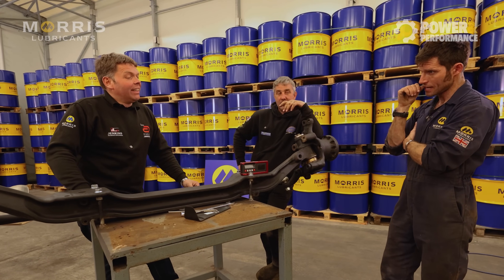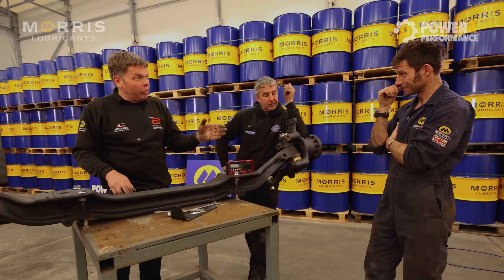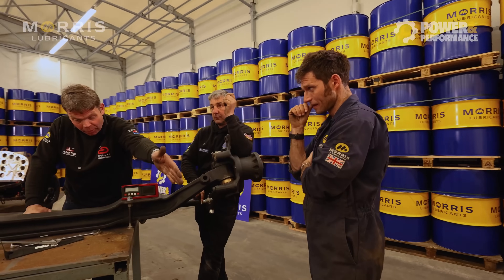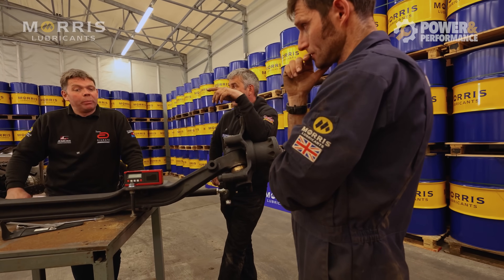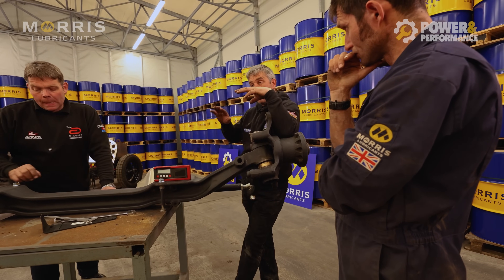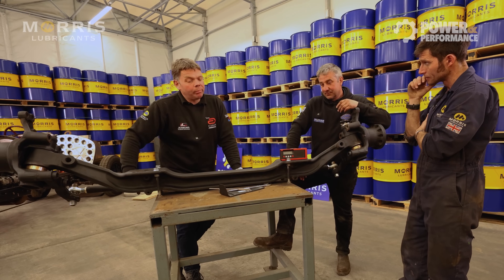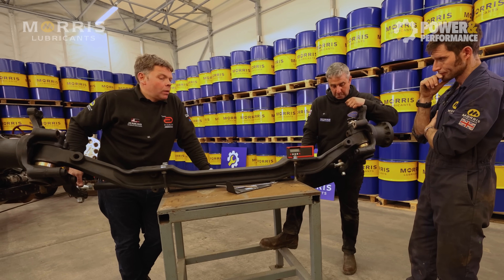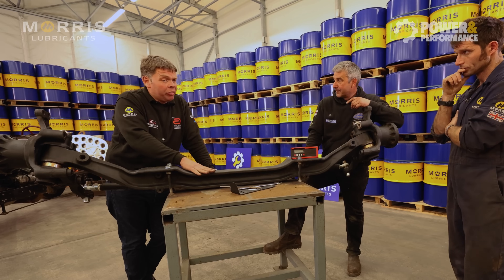That's at the end of the race — with a little bit of water and fuel left in it, as it would be at the end of the race. I've always had 150 kilos difference in the corner weights before, and now I've put it down to six — because I've taken that steering box from there and put it here. So it's centred and it's lower. I've had to put a bit of linkage in so the column goes down, bends around, and comes back. We're 10 days out and then we go straight to Grand Prix — Short Indy track. And we raced Snetterton in September and then Le Mans a few weeks after that.